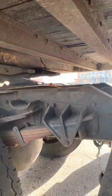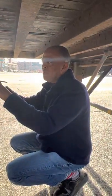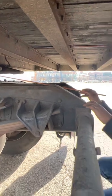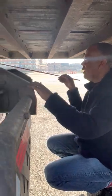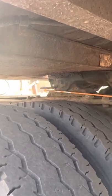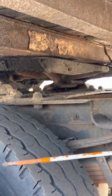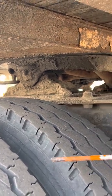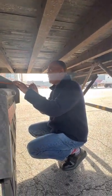Inside this fifth wheel, there is a kingpin — the kingpin is located on the trailer. Make sure there is no damage; it needs to be greased and lubricated. And there is a kingpin jaw or kingpin lock. Every time when you do the inspection, the kingpin lock has to be on the locked position. On this side is the release arm — the release arm, always when you do the inspection, the release arm has to be on the locked position. Every time when you unlock it, you need to pull it so you can see when you pull it and when it is locked. Make sure when you do the inspection the release arm has to be on the locked position, and make sure it's not damaged or illegally welded.